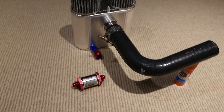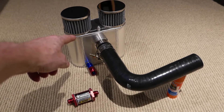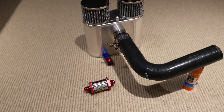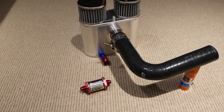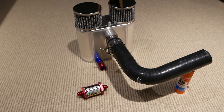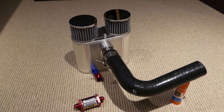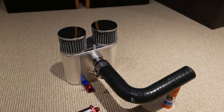The way this system works is I have a quart — 32 ounces of capacity — and that would exit out the bottom through some number six stainless line, through the flapper valve, and into the second port on the INA oil pan. Then this connects to the crankcase breather at the front of the block through some connections.